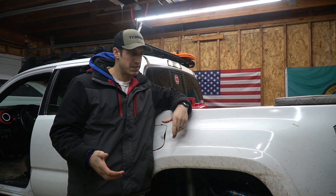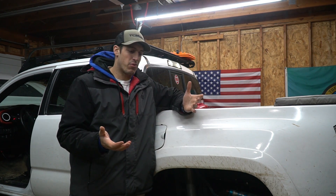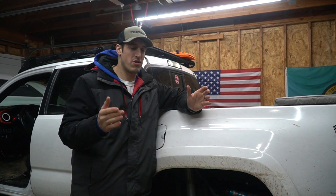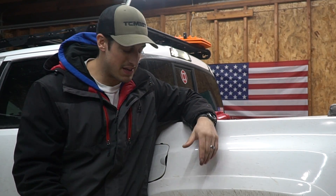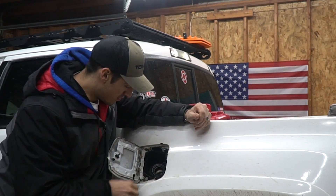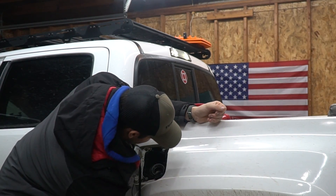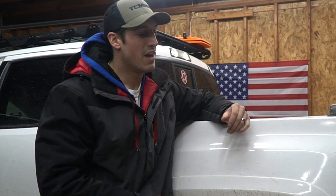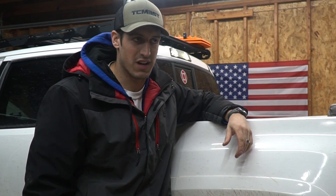I did a deep dive on Google and learned a ton about my evap system. Essentially it takes evaporated fuels, scrubs them through an activated charcoal filter, and pushes them into your engine to be reused. Mine has a very small leak — it could be a pinhole leak, a leaky hose, a leaky gas tank, or just a loose gas cap. Another problem I might have is this fuel neck being loose. I think that happened because we filled up in Oregon and let someone else fill our tank — it's illegal to pump your own gas there in most places. I blame them.